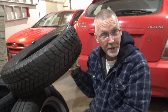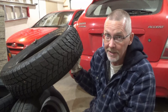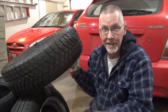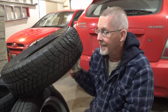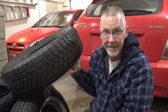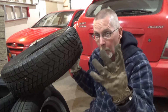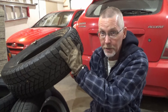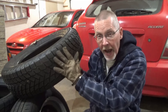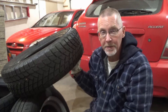There are a lot of different things manufacturers do. Toyo ground up walnut shells into the rubber and it stuck really well to the ground. Back in the day I just put winter tires on the drive end of my vehicle, but Toyo made some skookum tires that gripped on the front of my front-wheel-drive Mazda. After hitting a guardrail on the Coquihalla, I got back to the tire shop and had two more put on the back. Since then I run four winters. Bridgestone Blizzak is built with a foam rubber for the first half of the tread, and after that it's normal rubber — that foam suction-cup kind of grips to the ice as well.